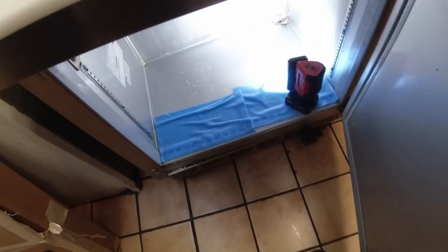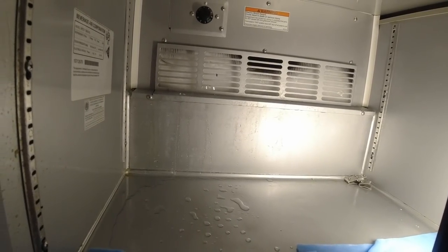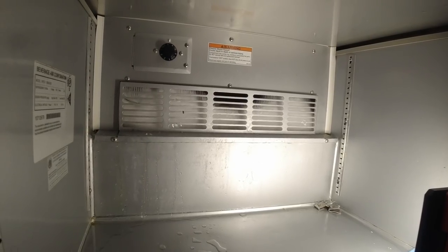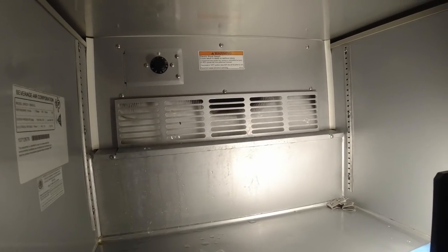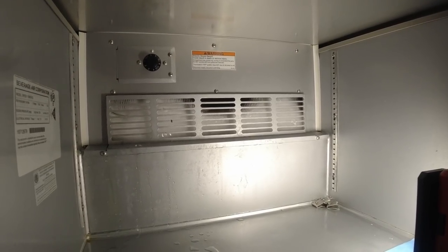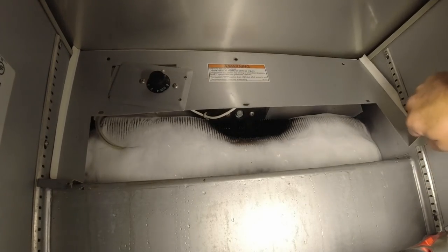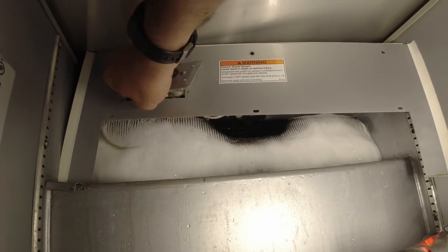Now working on the second unit. This is my fault for not seeing the other equipment on my call slip. When you've got this much equipment in a place where they can't work around you, you need to schedule it for later. This is pretty much the exact same thing as the other one — same brand, same scenario. It's interesting that both are freezing up, which tells me doors are probably getting left open with high humidity. This one's unplugged and in the back corner of the kitchen, so I can pull it out freely.